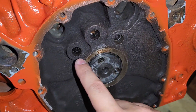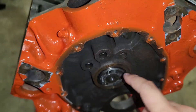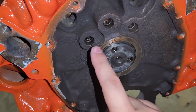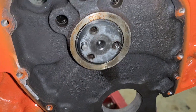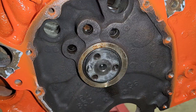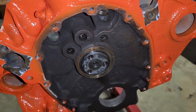In this front section, these are the main oil galleys. If you want, you can tap these and use the included pipe plugs, but you don't have to — you can just put the regular push-in style plugs in. A lot of people gripe that they can come out, but honestly it's fine if you just use the push-in style. If you're afraid to get the tap out, it's all good.